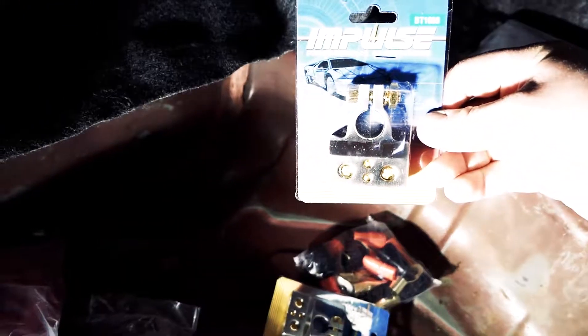Let's see what we got here for the trunk — battery's right there and I have all these pieces. Zero gauge wire, got black for your negative, red for the positive. You got these connectors where you use a little allen key on one end and the other end goes right on the battery, and then you get your other end to make the connection under the hood. Probably gonna run this down under the car, self-tapper screw it to the side of the frame rail so it's nice and neat.